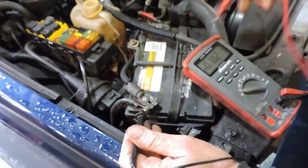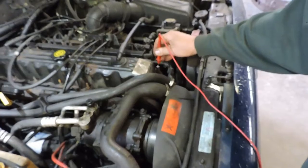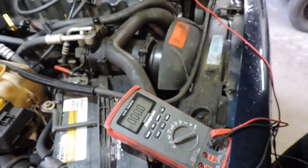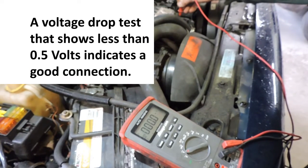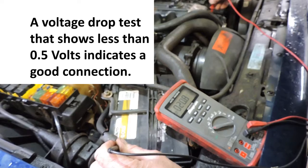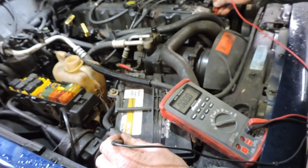I'm going to start with a basic ground check. I've cleaned a spot on the engine — I'll put the black terminal right on the battery post and put the red lead on a good ground and wait until the meter zeroes. When I crank the engine and induce a load, ideally I'd like to see zero volts. Any voltage indicates higher resistance in the connection — in this case the ground cable to the engine. Going ahead and cranking it, I'm reading about 300 to 320 millivolts, which is less than half a volt, so that's probably within specifications.